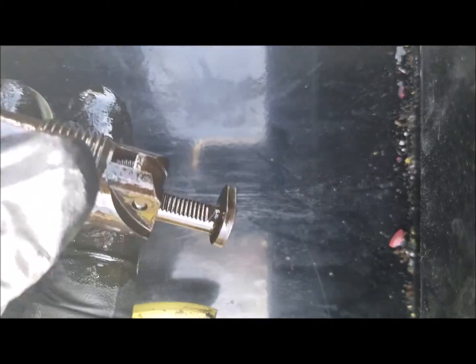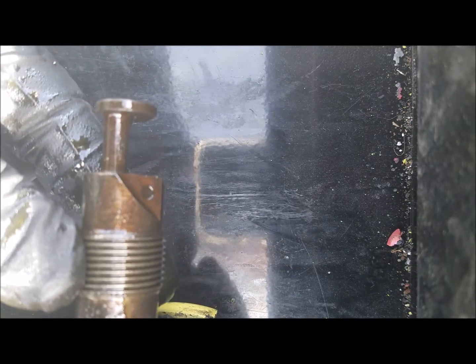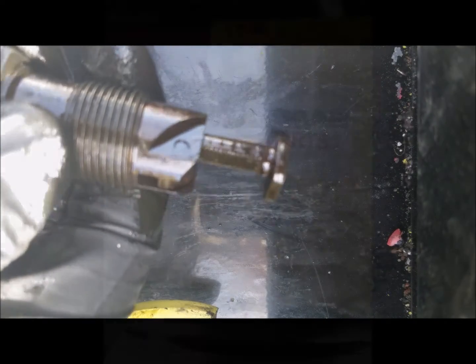To reset the tensioner, there's a little tab right here that you want to push in. This resets it so that when you put the spring back in, it will re-extend the tensioner. You can put it back in as-is since that's where the extension was anyway, but I like to reset it — just push in on the little tab and that resets our tensioner. Then when we go to put the spring back in, it will extend back out to where it needs to be.